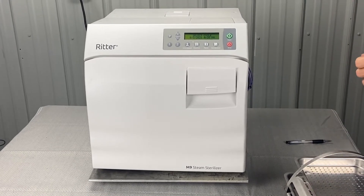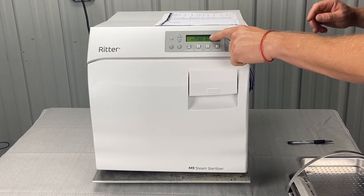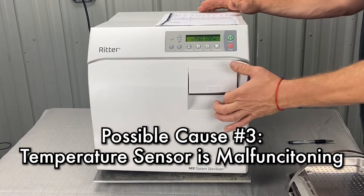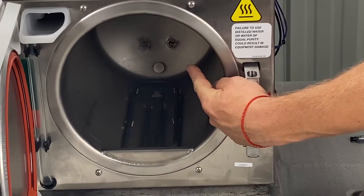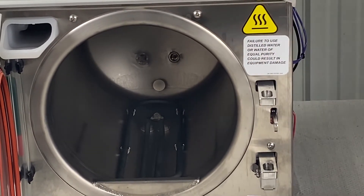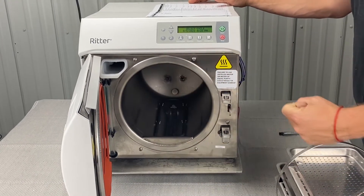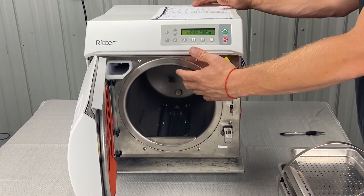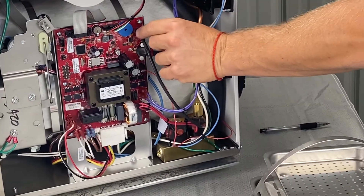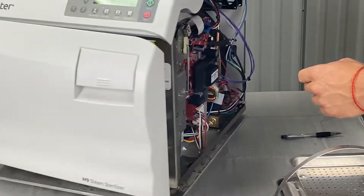Verify the water on the sides of the chamber. For error code 633, if the unit is building temperature and you're seeing the temperature rise on screen, it could be that the temperature sensor is malfunctioning. Check for residue buildup on the temp sensor — that probe sticking out the center. Make sure there's nothing on it; clean it with Speed-Clean, distilled water, and an abrasive pad. Also check that nothing is touching or crowding the temp sensor — pull all your trays and rack out. You can also perform the temperature sensor resistance test by pulling it out with the unit unplugged and hooking up a multimeter to get the specific ohm rating.